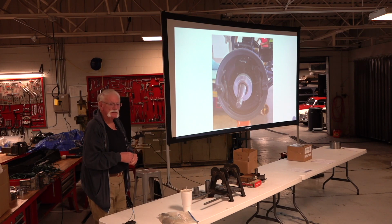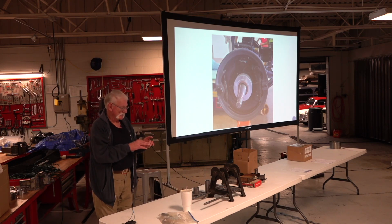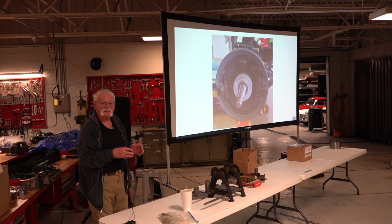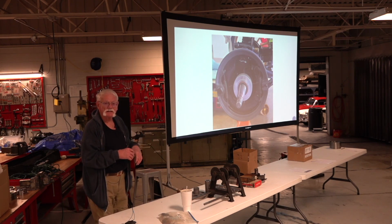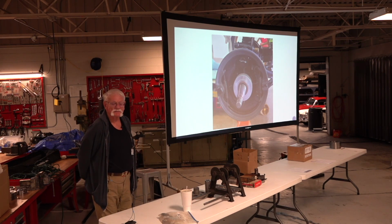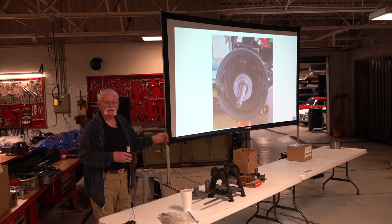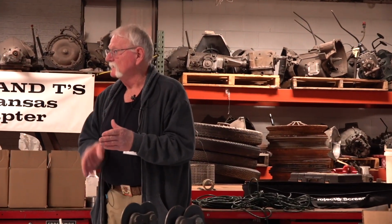In fact, I make some of my own. I machine some of it's my own. Like a neoprene or something? There's just a neoprene seal that presses in there, and I've got a little brass ring that I brazed into that cup, and then machine that all down. The bronze ring runs on the end of the bearing and kind of keeps it, rather than having that cup and the felt and another washer in there. To me, if things go south on you, you've got that washer wanting to slice off your axle. And that's what kind of bothered me a little bit, that washer's generally pretty stiff.